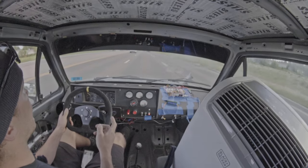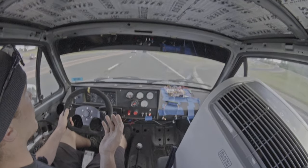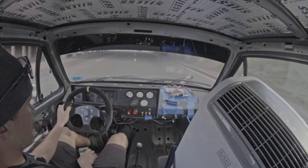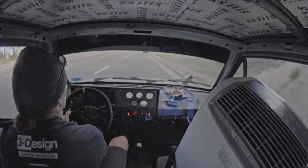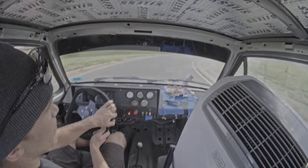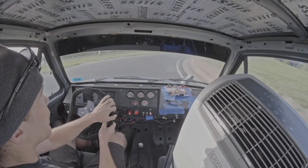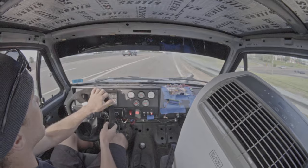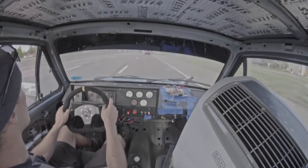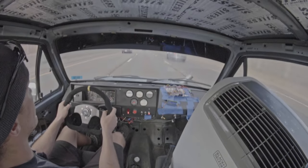I think the other setting I need to play with — and what will ultimately make this tune a lot better — is if I raise the minimum drive pressure to like 6 or 7. That would make the response time better off the line; in first gear it's still pretty slow. Right now 26 psi is my boost limit and 18 is my drive pressure limit. I think drive pressure is going to matter more. We're in third gear — that was pretty fast, actually.